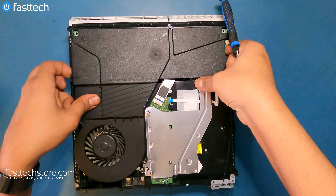For demonstration purposes, to show you guys that this works, I am going to temporarily use this antenna. Obviously we're not going to be shipping out the console like this — we're going to use the OEM antenna — but for the meantime I will install this to show you guys that I am telling the truth. As you can see, this is slightly longer than what we need, and that's okay. We're just going to place this antenna here, reinstall our power supply, put the connector back in, push it down, and now I'm going to reinstall the two screws that were holding the power supply in.